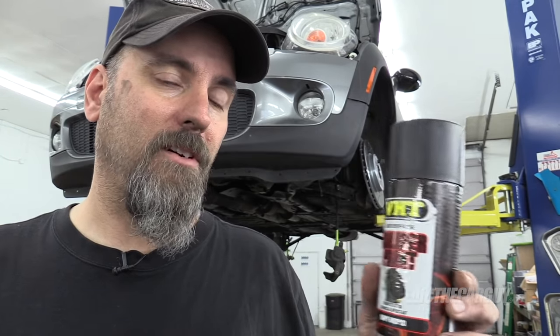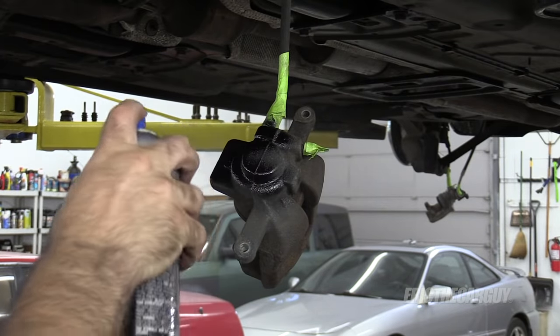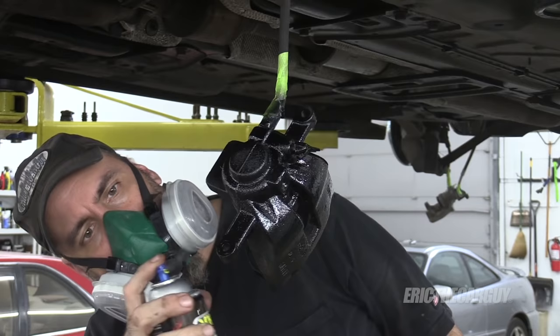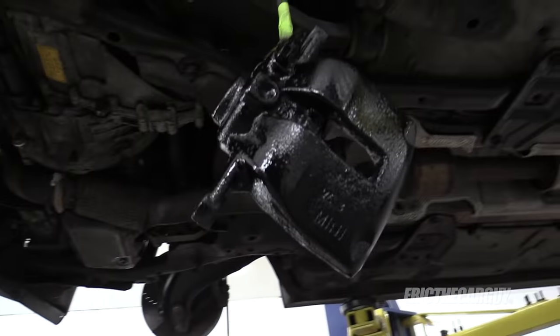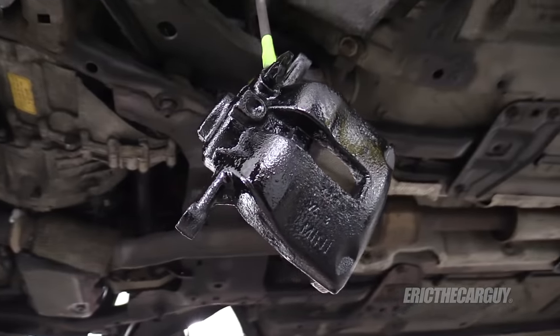I'm not so concerned since I'm using dark paint and I'm doing this to turn around and sell it. You can take this preparation as far as you want — 95% of this is going to be the preparation you put into it. A sandblaster is the ultimate. I have everything set up here inside the shop, but it's also better to do this outside, and wear a respirator when doing this. You don't want to go too thick. You can always come back and put another coat on, but that's the general idea.